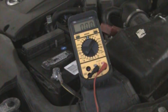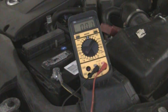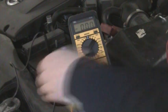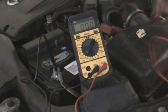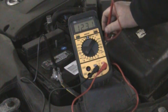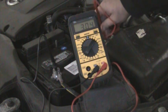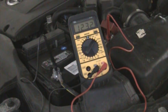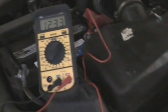This is a sign to tell you whether it's good or not — just what voltage it's getting without load. People can confuse this and say, 'Oh well, it's getting enough voltage, it's good.' Put your black lead on negative and red on positive. We get 12.32 volts. That's not completely charged, but that's not really a bad reading — that's about half charge. But you might think the battery's good; not necessarily.